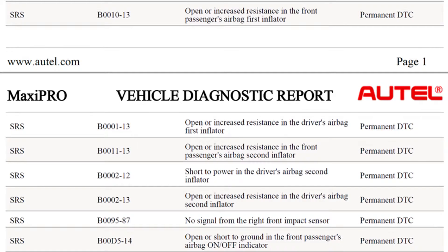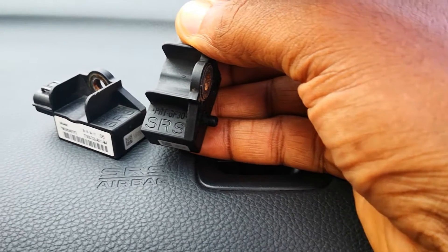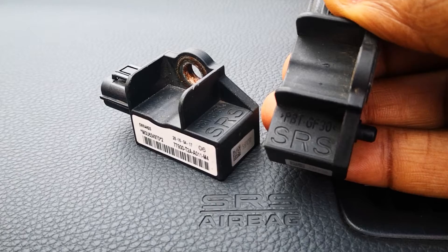As you can see here, I have a scan result of a similar car which was involved in an accident. There's a code for the front crash sensor. The SRS module or ECU relies on crash sensors to sense sudden deceleration movement and thus deploy the appropriate airbag.